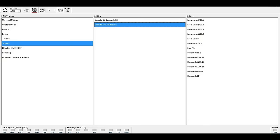Okay, welcome back. We're on the second part of the process with the base replace drive that we did, the 1.5 terabyte Seagate, and I'm going to now attempt to clone the drive now that we've actually replaced the spindle motor, enabling the drive to spin back up correctly. So we'll put power to the drive.